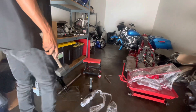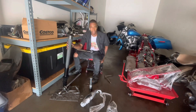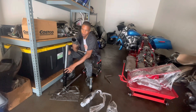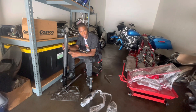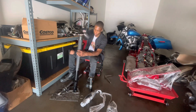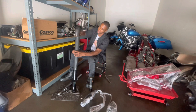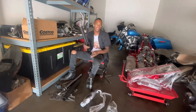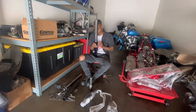As you all can see, I use this little hose right here — like a vacuum hose. You can get a tube from a hardware store like Home Depot or something. But this seal basically — the hole sits right above the seal exactly on the edges where it can go down if I hit it from the top. I'm going to go ahead and pin this down. I got a rubber mallet so it doesn't cause any damage. You can just feel it go down in one to two or three hits. But with that grease, it makes it beyond easy. Just like that, we got the seal all the way down nice and perfect. This is when you put this little ring in and the ring basically keeps it locked.